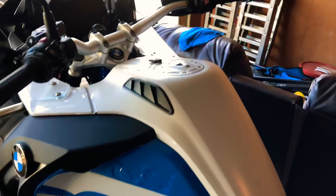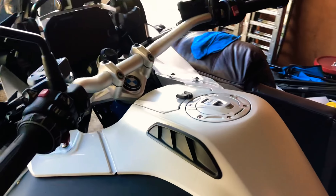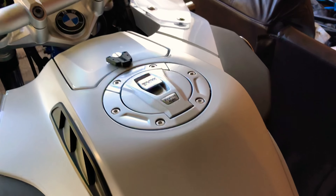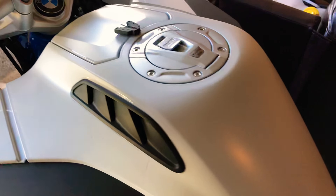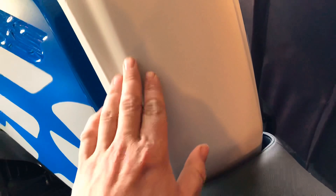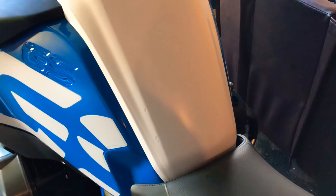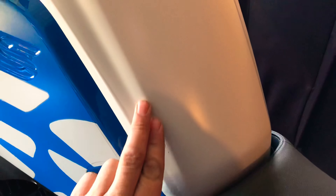I've put these on three different bikes I've owned and one of my friend's bikes, and usually they go on pretty straightforward and easy. This one here was a little bit more difficult. Other than this little glove compartment, this tank is all one piece. I've got a couple of bubbles left below here — usually that's not an issue. It's been cold out the last few days, hovering around just above zero, and these usually go away sitting in the sun for a few hours. I don't want to mess around with it too much. The last one I used a heat gun and got a little too hot and created a big crease, but this is the kit.